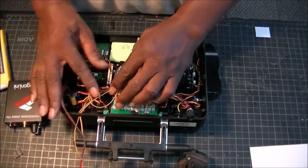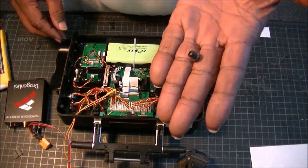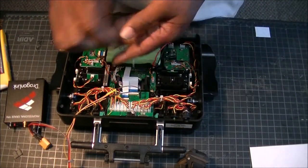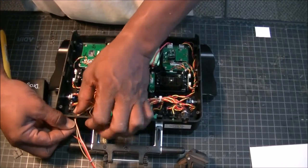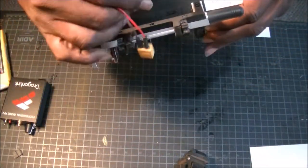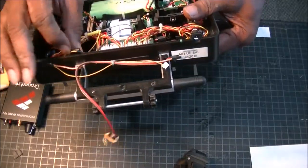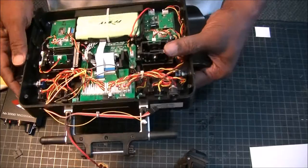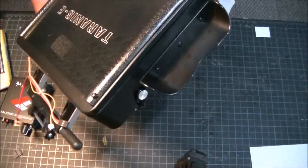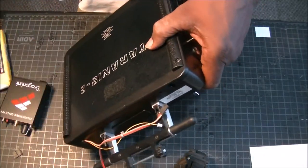So basically, now we're done in here. Secure your wires. One of the things I did was — I'm notorious for losing little small things like this. It doesn't mount anything, but it's a plug and I wanted to keep it with the radio. So I put it in — now I'm not going to lose it anymore, and it's holding my wires nice and firm. They're not going to have excess wire on the outside. Once this is done, make sure your wires are clear, go ahead and place your cover back on the rear. I'll screw all the screws in lightly, then nice and tight.